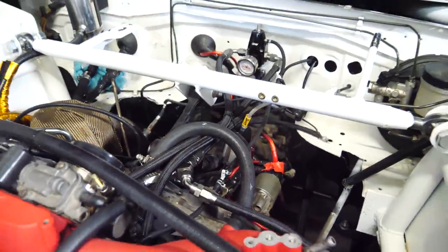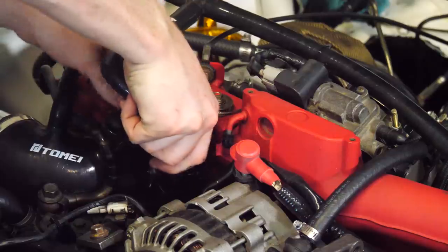This is that main line. There's oil there, oil there, oil in there. The location of the blow-off valve, which is right here, everything is kind of oily, as you can maybe tell. Probably not. Yeah, we're definitely having a lot of blow-by.